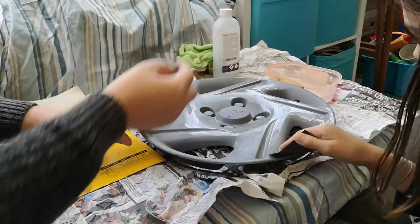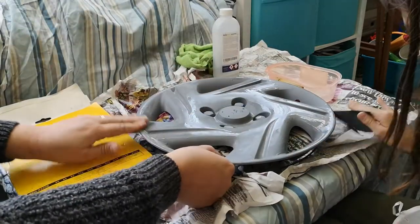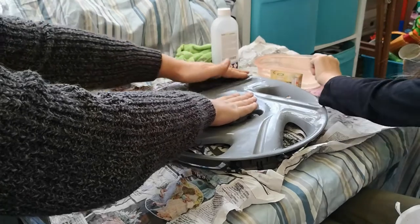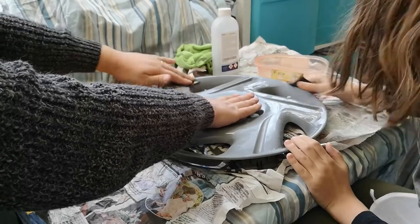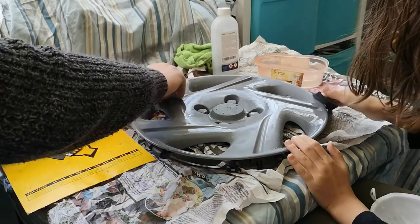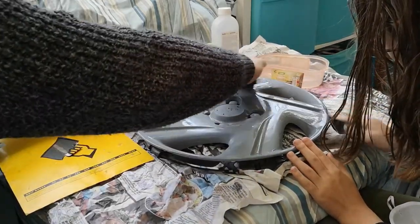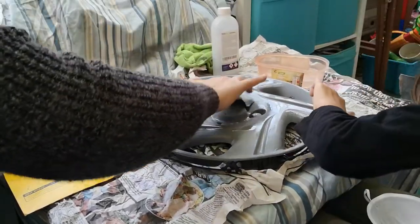It is going quite quickly. I could see it was rougher in part before and now it's not. Yeah, that's exactly what you want. So when you do this, you're smoothing the primer out, and as an effect, you're also smoothing out the imperfections. That bit there, the plastic was quite badly damaged from a previous scuffing. So don't worry if you can't get it to be absolutely perfect. There are some areas that will not be perfect, but they're not going to be bad.